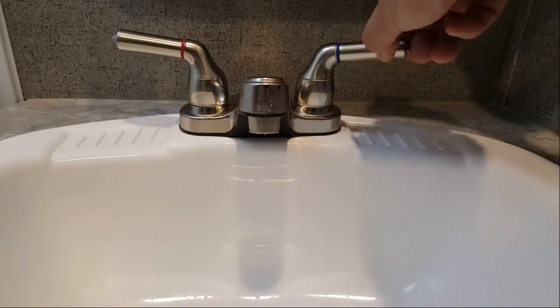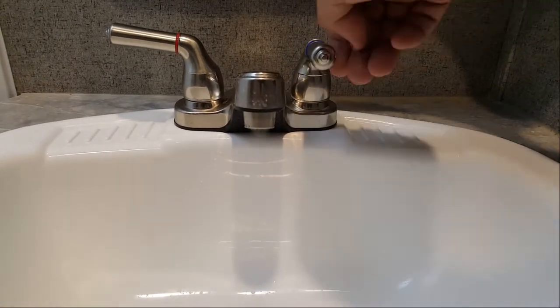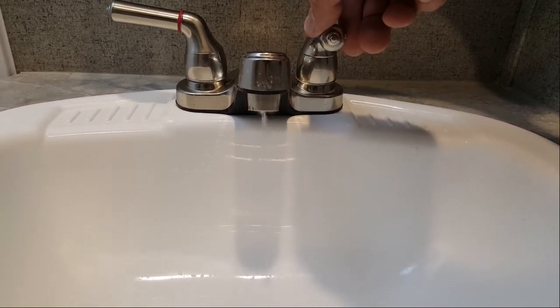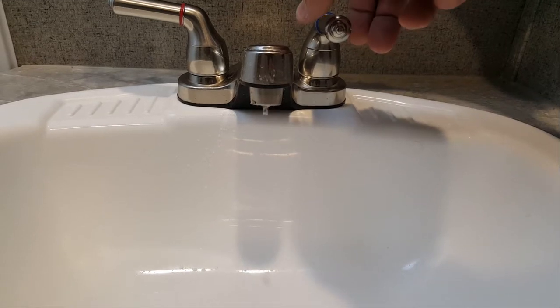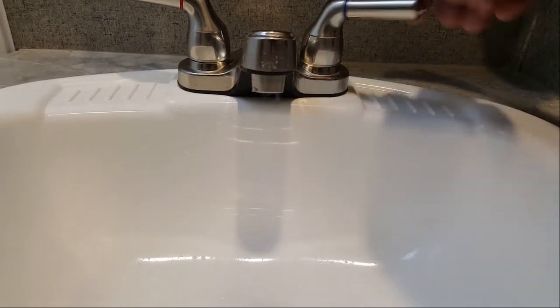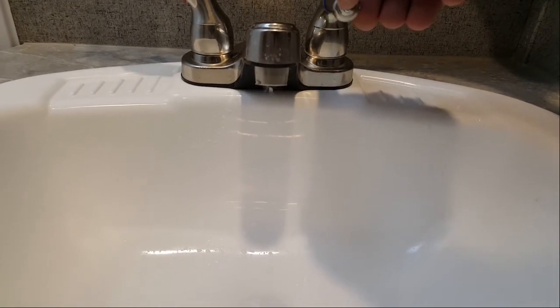You may need to turn off the faucet and let the pressure build for a few seconds before opening back up. Do this until only air comes out of the faucet. Don't let the air compressor remain on for too long though, or it may cause damage to the compressor. I turned mine off and let it rest in between faucets.